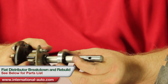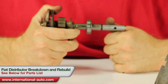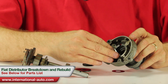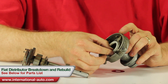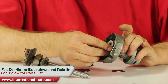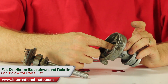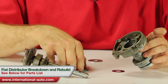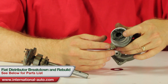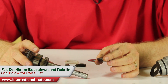This is the top bearing — it's stuck to the shaft on this one. As you can hear when I spin this bearing, it is definitely bad. This plastic washer has two notches in it and they fit into the notches in the distributor. The notch is right here — it's going to be the top piece, and the bearing is going to be below it. You're also going to have a felt washer below it, and then there's a small metal washer that goes between the bearing and the advancement plate. That's the thicker washer on the bottom; the thinner one goes between the bearing and the advancement plate.